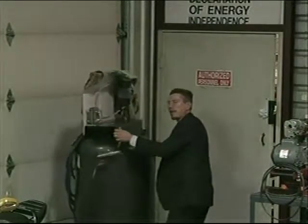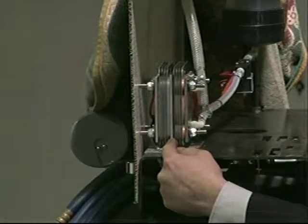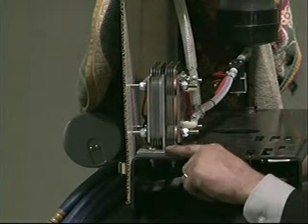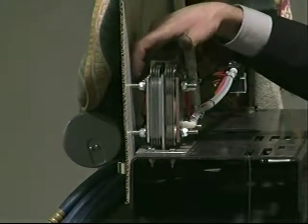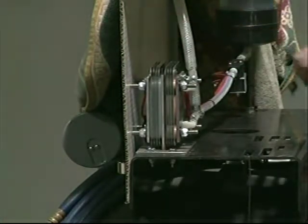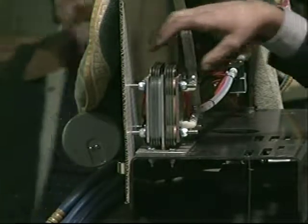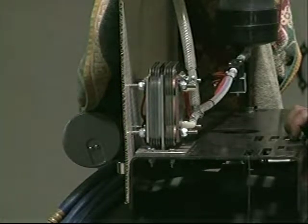Now, for this one, instead of passing stuff around, I'm going to ask you to come up because this just doesn't fit between the aisles. Come on up, guys. This centerpiece here is the negative plate, the cathode. It comes down and is welded to the mounting plate, so that grounds out this system. And this far end plate and this far end plate become our anode. These are our positive plates. From the center over is the same as that big bulky fuel cell that we've been passing around. From the center over that way is like a second fuel cell, both of them combined into a much smaller, lightweight package. Everyone got that?